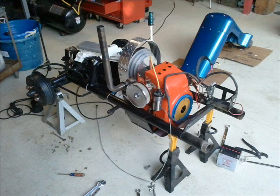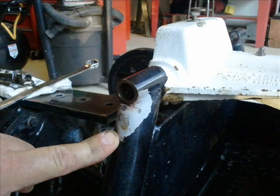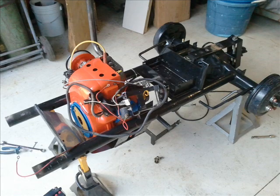Here I'm ready to take the jackshaft off and the shield for the belt. A couple of bolts are rusty — they're socket head cap screws. I like to use all the same type of hex bolts, so I'll replace those. You can see a lot of stress was on the support for the jackshaft because the paint peeled off of it — I'll check that closely. Here I've taken the jackshaft off, and the engine will come right out next with four bolts.